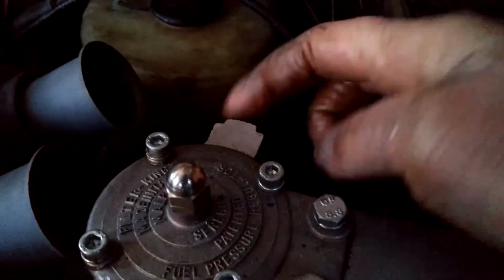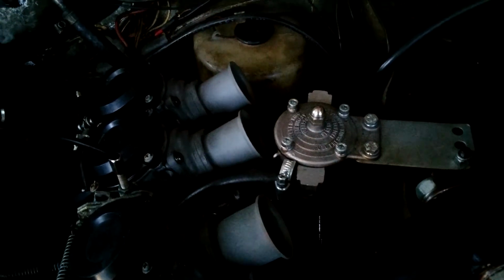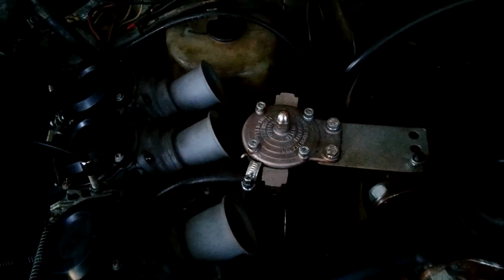So I figured out what part of the problem might be. I have a fuel leak, absolutely stinks. Coming from this side, I think it's just the pipe going into the, don't know if you can see, there's a wet looking pipe in there. So I'm guessing not a lot of fuel was getting through because we were getting no ignition. I'm going to try and stop that leaking, I hope, and try and turn it over again. Just hope I don't run the battery flat. Here we go.